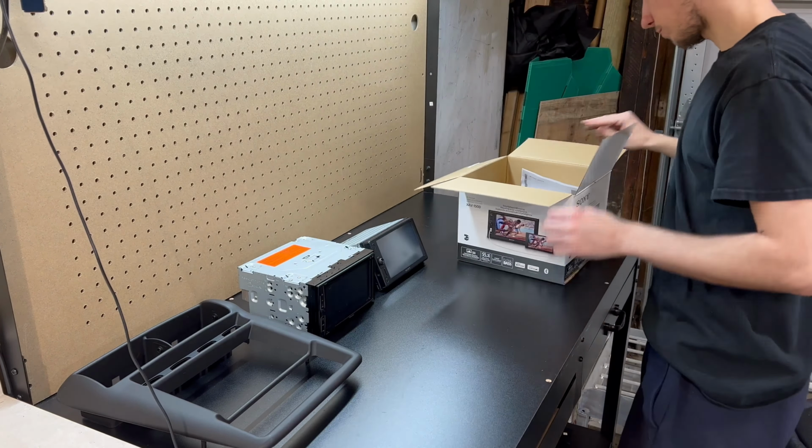So, we gotta go into the car and take off the old radio bezel and radio. So, let's go ahead and do that. So, this piece here has gotta come out. It's actually really easy to come out. I'm able to do it with my hands. You just gotta find a piece, gently tug on it, and work your way down. It's got little clips holding them in. So now that they're off,